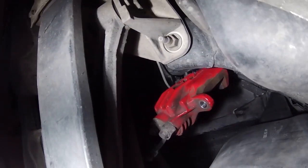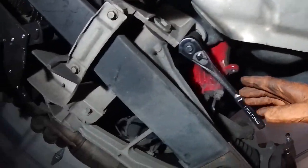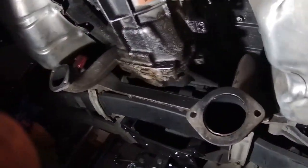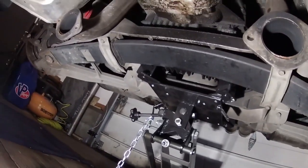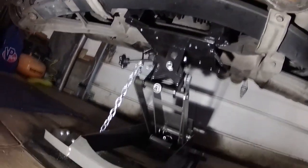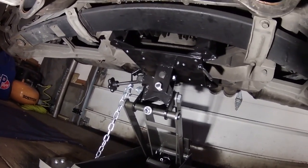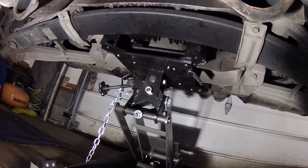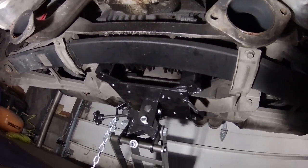Here's the next one here. It's right behind where we hung the brake calipers. Okay. I've got one of the subframe bolts out now. I'm working on taking the other three out. And once those three are out, the whole subframe should be disconnected from the rear. And then I could disconnect the torque tube of the bell housing and then start lowering it out of the car.